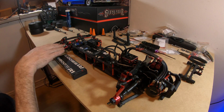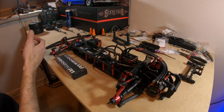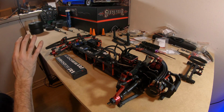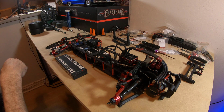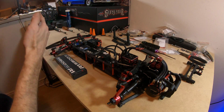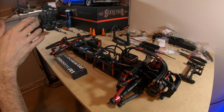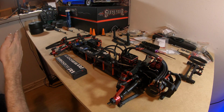Another main thing is that the bulkhead is in a reverse position. So instead of being on a kick up angle of 30 degrees, having 30 degrees of caster, because the bulkhead is flipped around, it's got zero kick up, so there's zero caster. So the wheels stay true when it's driving. They're not gaining camber when you're trying to steer, making it carve while you're trying to make corrections. This will make you steer more true.